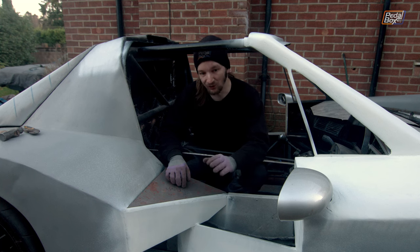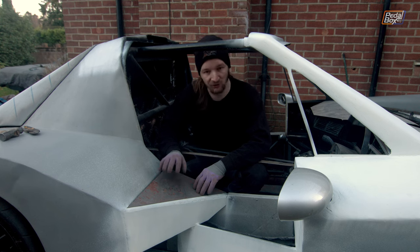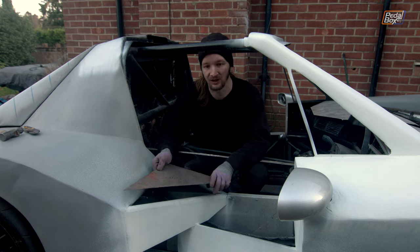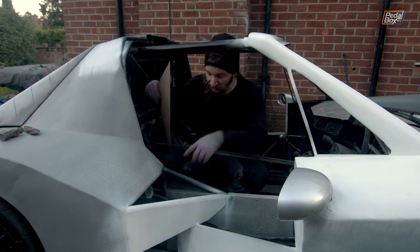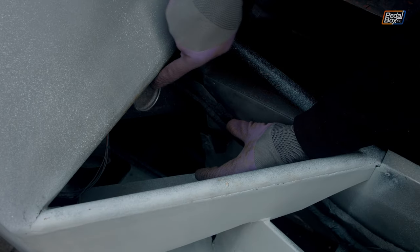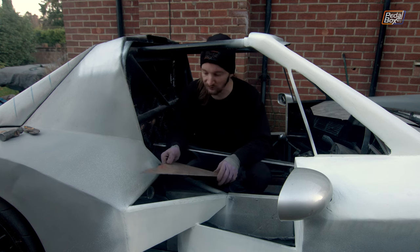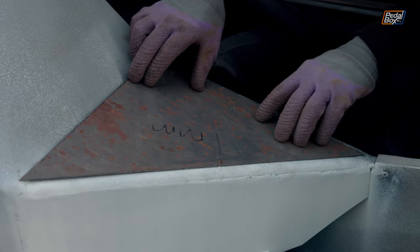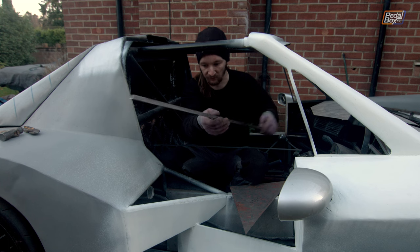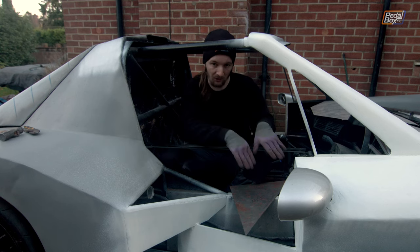You'll be happy to hear this isn't the whole episode of just us putting seals on bits of car — we thought that'd get boring after about 30 seconds, but I think we've given you about five minutes of it anyway. So we're going to give you a bit of fabrication now, getting back to form. This is a piece of metal that we cut and shaped quite a long time ago — you can tell from the rust — and we've been putting off putting it in because it's not quite as simple as just welding it on. It actually needs to be removable because underneath here on both sides is the air connection from our boost bar that runs across the car to the intercoolers. The intercooler exit is just about where my hand is, and we need to be able to get a silicone elbow on there, so this panel has to be removable for access. It's going to sit on here like that eventually, but we're going to build up a little frame underneath it first out of some bits of angle iron — our customary half-inch or one-inch box cut into halves and quarters — and some flat bar, so that we know it fits and everything aligns, and then we'll weld that skin onto it.